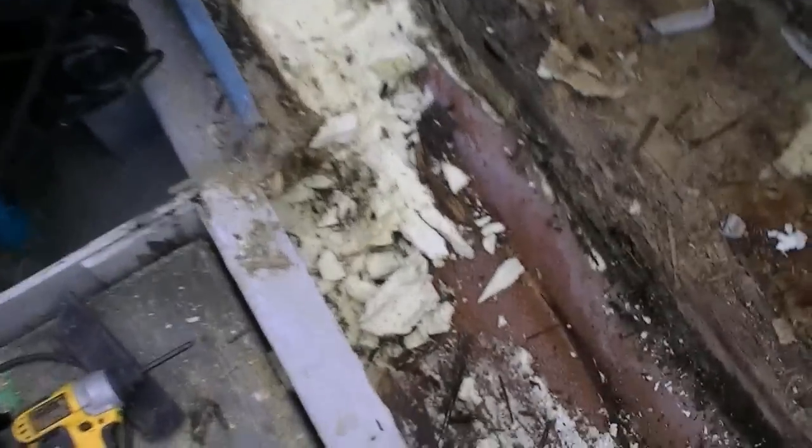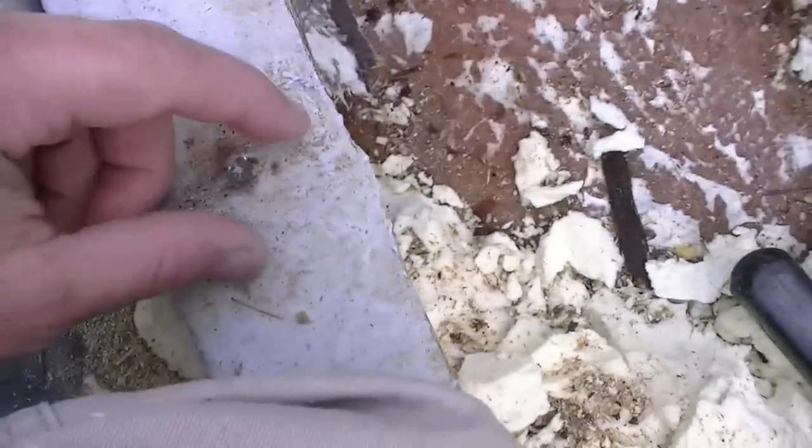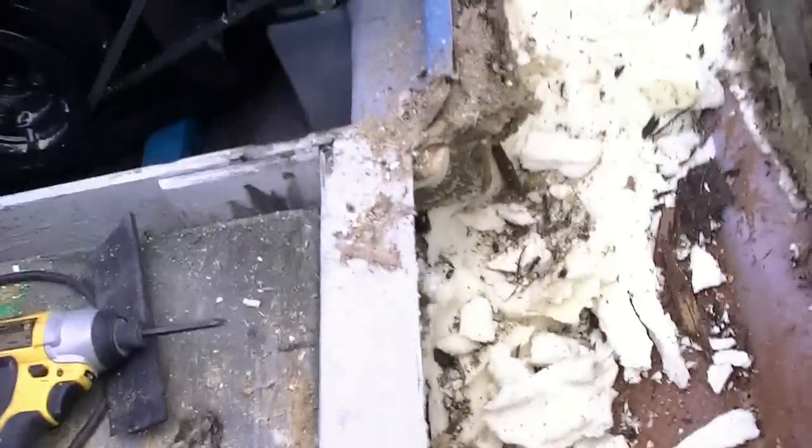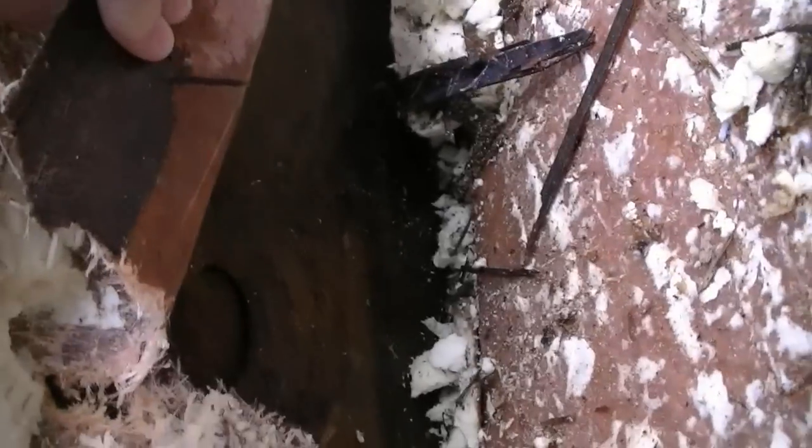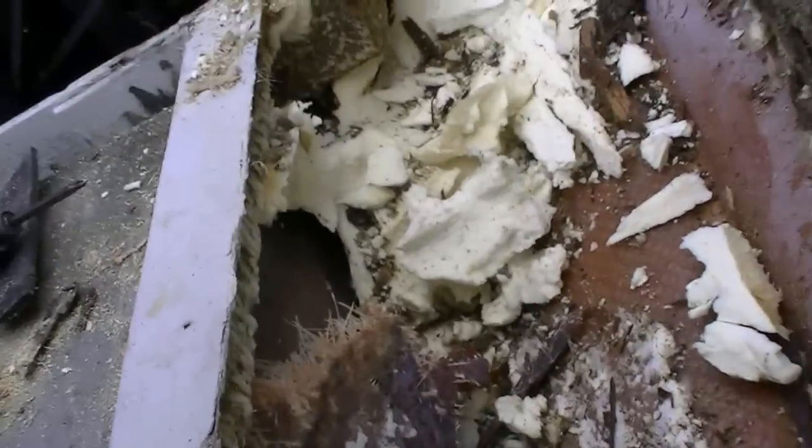This foam is a pain in the ass. You got to watch out for your knees — these stupid little screws sticking up trying to get them all out. You can see what freeze damage does to a stringer when water gets down in there. The stringer runs up this way and it was laminated in fiberglass. I noticed how soft it was when I was pushing on it. If you pull it up, there's your stringer — it's just black, it has not rotted yet. Still going to get cut out, but at least it'll help me make a template.